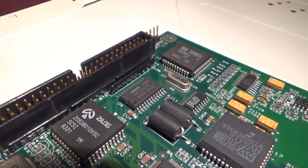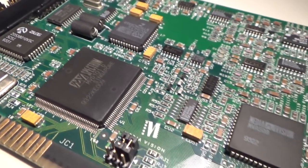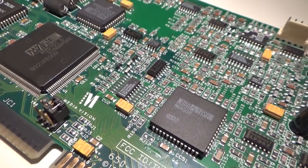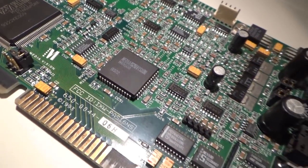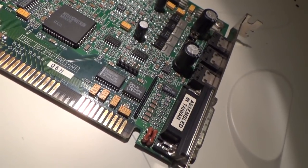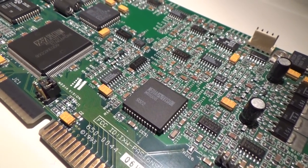For PCM, the PAS16 is not directly compatible with the Sound Blaster, which is unfortunate, but a solution was offered, in the form of including the chip from MediaVision's earlier Thunderboard, a Sound Blaster-compatible card, on the Pro Audio Spectrum 16. Unfortunately, this means that games with only Sound Blaster support will have you limited to only 8-bit mono sound, as with most alternative cards of the time, but it should be at least good 8-bit mono sound.